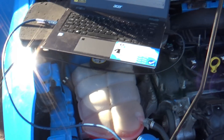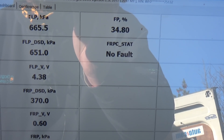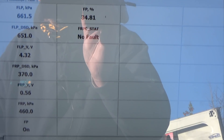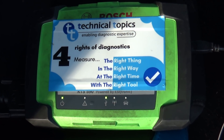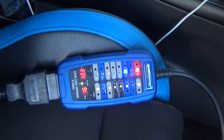Hope you enjoy the video. At the moment we've actually got the vehicle running. It's quite a nice tidy car. You can see we've got 4Scan connected, running on a bog-standard laptop. We're looking at fuel low pressure desired and actual, voltage from the fuel low pressure sensor, and then rail pressure desired and actual, and duty cycle. We've connected from the laptop via USB cable and we're actually using my KTS 590 as a pass-through device. You can use 4Scan with the low-cost ELM interfaces, but I'm actually using my KTS 590 in pass-through mode. And we've also got it connected to a breakout box.